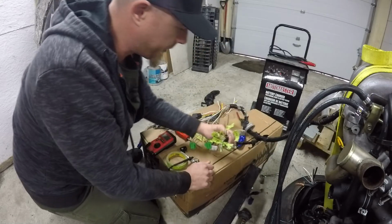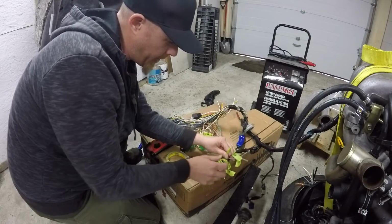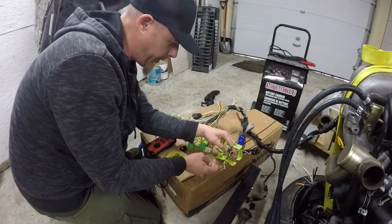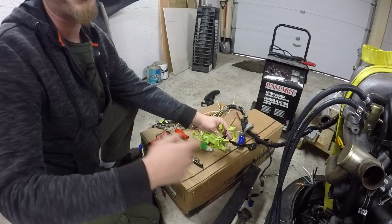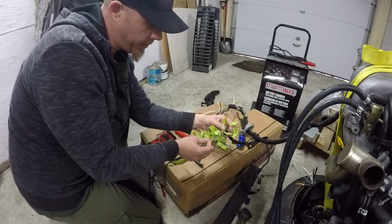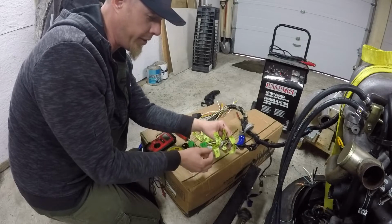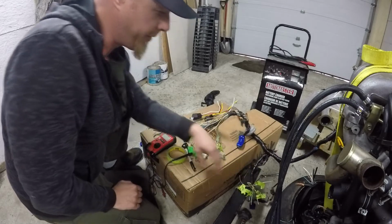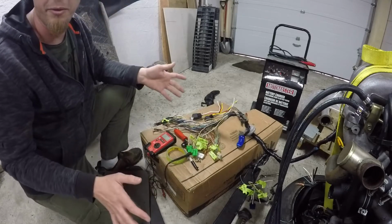And then coming down to this harness, of course I've already mentioned these need power, these bigger ones. This one also needs battery power, and for some reason the tach signal comes out here, I'm not sure why. The power steering switch, so the harness must have at least looped around the front of the back of the car, because the other connections here are for the mass airflow sensor and the O2 sensor, so that stuff does come out here. It won't be really needed to run it, but it's there, and I've kind of figured it out.